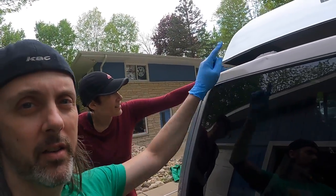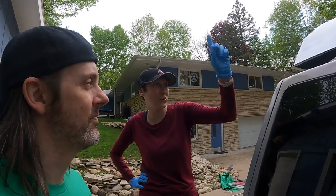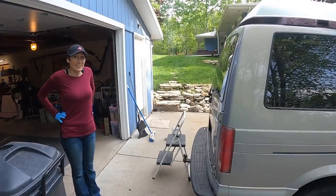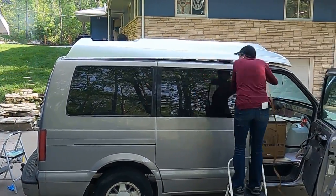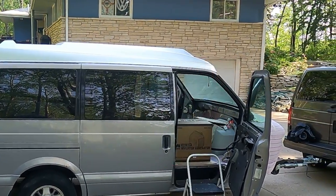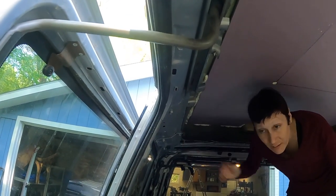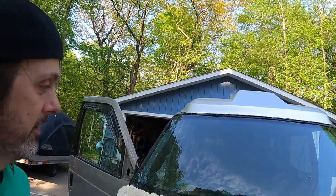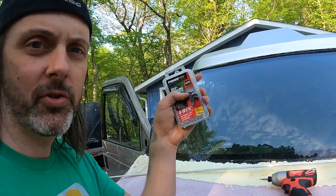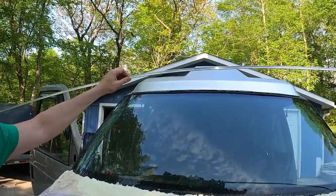We put an extra layer on the back corners as well. She's been questioning all of this — I wondered if we should do another layer on everything, and I'm going to confidently say I have no idea. Here goes nothing. Sarah is jamming extra butyl tape into the wedge between the roof and the high top where we could see little bits of daylight, before it's all clamped down. Now we're starting to clamp it — I'll start in the front and mount this aluminum trim with self-drilling metal screws by Power Pro. Not sponsored, just telling you what I'm using.